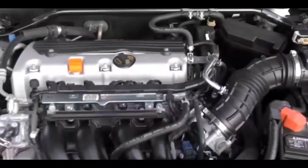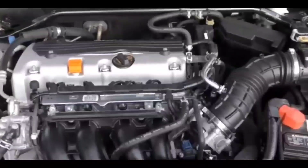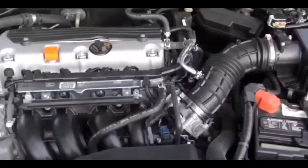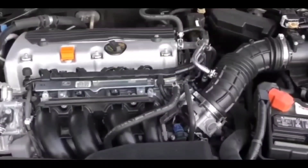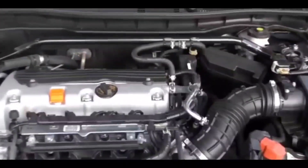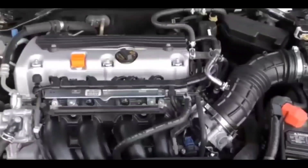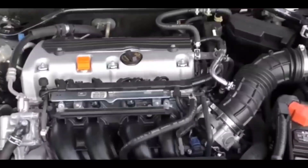Take the key fob — especially if you guys haven't changed the key fob battery in a while — take the key fob battery out and go to your local CVS or any place that sells these little flat batteries, buy yourself one of those batteries, replace it, pop it in, and try to start it. If it starts up, you're all in the clear. Now obviously if you guys are still having a crank no start situation, that's another issue, but you can at least rule out a low or dead key fob battery — which is definitely worth doing.